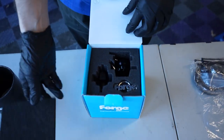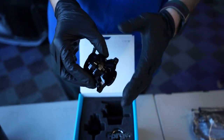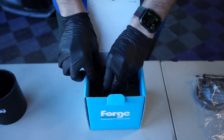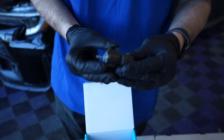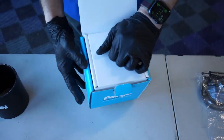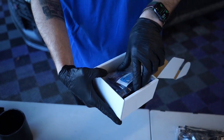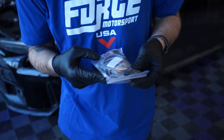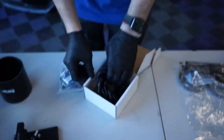I did keep our larger silicone inlet for the intake and the clamp - I shouldn't need this though, but it'll come in handy later. Let's take a peek at this dump valve. I love their packaging. So we have our valve here, this is gonna mount directly on the turbo itself. We'll definitely need this for the install. And then it looks like we have some sort of solenoid here. I didn't look ahead to see what this is, but we'll probably need it. Inside here we have a plug for the solenoid, some gaskets, and then some vacuum line.